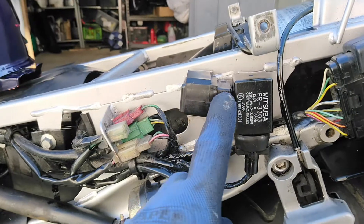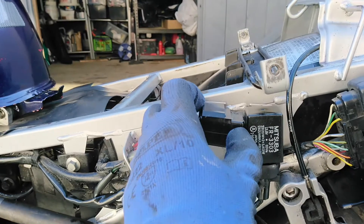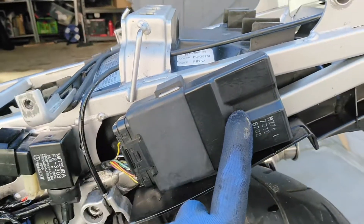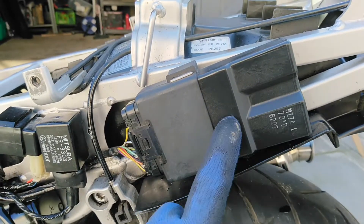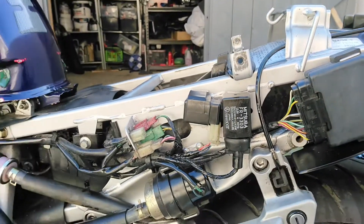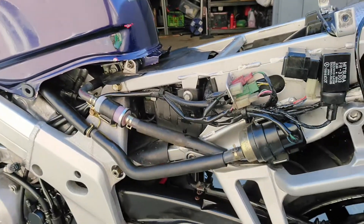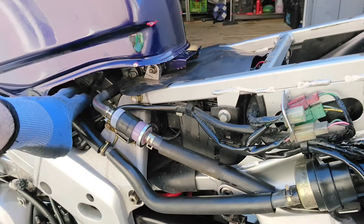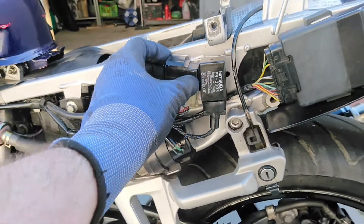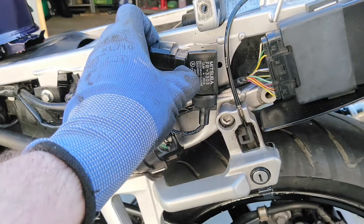The role of the fuel pump relay is really only there for safety. The fuel pump relay is controlled by the engine control module, which is this unit here. The engine control unit controls the spark that goes to the cylinders of the engine — it controls the spark in the spark plugs, which are just here. The role of the fuel cutoff relay is essentially: if the motorcycle has an accident and goes down...